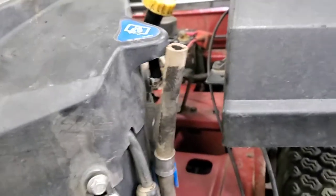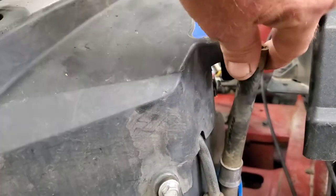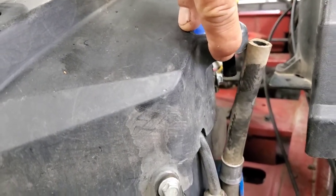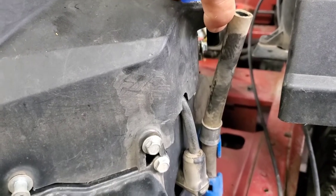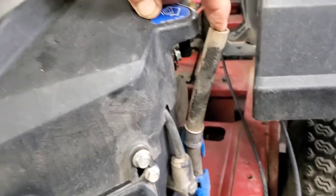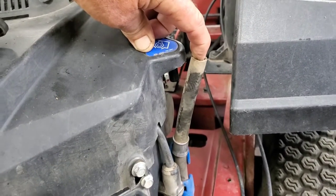Something to be careful of: these Toros have an oil drain here. Get you some pliers and turn this, because if you don't — can you see this nipple down here? They are bad about breaking off, so be very, very careful with that. If it does happen to break off on you, you can just stick a bolt and a clamp in there and you'll be fine. So let me pull this engine cover and I'll be right back with you.